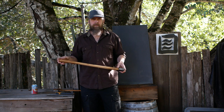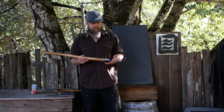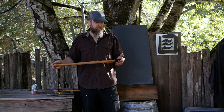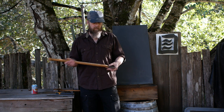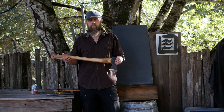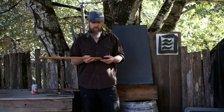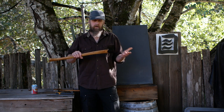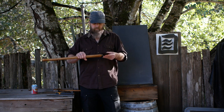The real reason I bought this axe is because it provides a lot of talking points as I go through and modify it into something I would consider a much better axe. I see a lot of videos where people are getting stock axes and just using them the way they are — I never do that. My complaint is not that no one should have to do any work to their axe head or handle. My complaint is that with minor changes this company could create a lot fewer problems for users by making this head-to-handle fit better, because it's a very poor fit. This handle is exaggeratedly thick and that's not necessary — without any extra money or expense, just a little bit of redesign where this would fit and mate better.